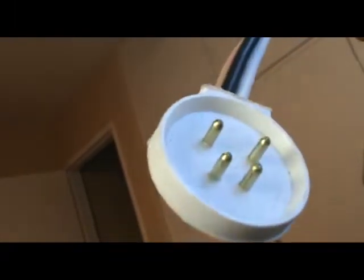Don't worry about what your harness looks like that you have. You've got to throw these harnesses away — they're no good. You're going to unplug this flat end. You see that tab right there? That's the key to getting that out of the head of the ice maker — you've got to push down on that tab. And that tab is hidden underneath the white cover. You have to take the white cover off the front of the ice maker first to see this tab.